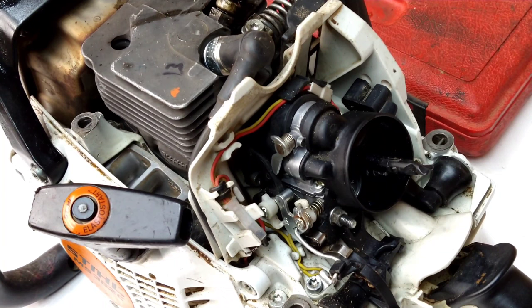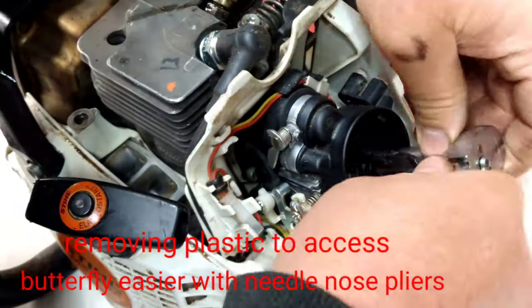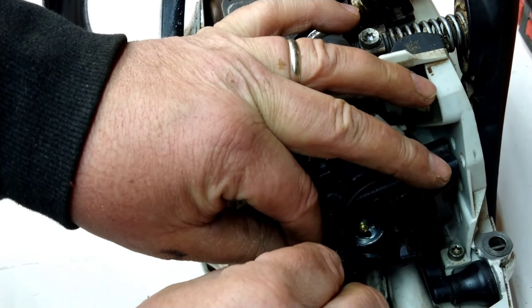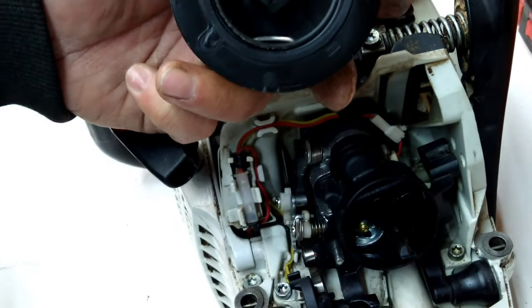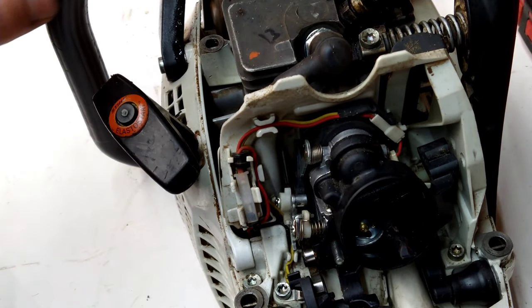So, we'll use a 5/16 socket. You have a nut here and one inside here. So let's get those off. To get this off, let's make life a little easier so we don't lose the rod. Pop the rod up out of there. Let's take that out. Set it off to the side so we don't lose it. What I like to do so I don't lose it, throw it right inside the air filter. No, you're not going to lose it. Same thing with the two nuts you took off. Throw them in there. Not going to hurt anything.